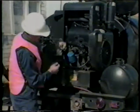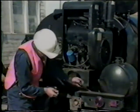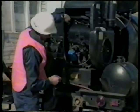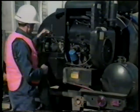The second thing to check is the crankcase breather cap. Make sure that it is not dirty. If dusty, tap or blow all the loose dust out. If clogged with oil and dirt, wash in solvent. Replace and secure the cap.